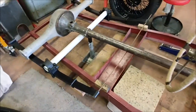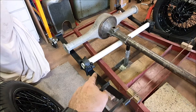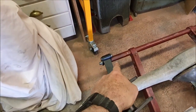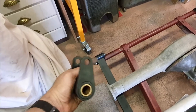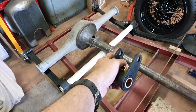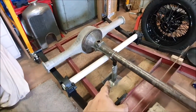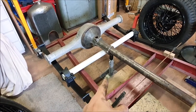To get rid of the torque tube I have to undo all the brake mechanism. Now that I have this more or less in place, I'm probably going to use a temporary bar through the front to prop it up in the right position. I also need to make up some fake pins for the back — it's just held with bolts at the moment, but I don't have the right diameter pins, which I need to order from the UK. I'll machine up something temporary to hold everything in the right place, figure out exactly where the centerline of the axle is, and then I'll know exactly where to cut down the torque tube. The driveshaft will need to be professionally shortened because it needs to be re-splined at one end. It's getting a lot closer to actually going back on its wheels.